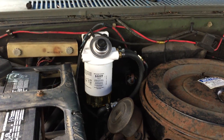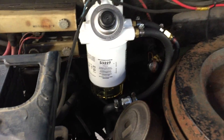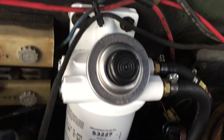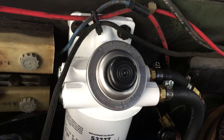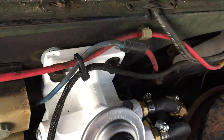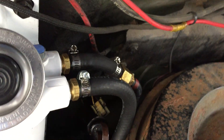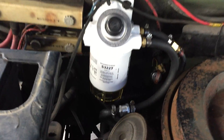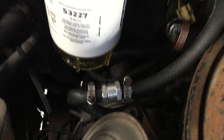While I wait on that, back to the filter. Just like that, we are all done. The filter body is bolted right into the original holes with the original screws, with a couple of washers behind it to give a little lift off the firewall. I've got the little 3/8" nipples coming off — one of them has a converter that brings it from 3/8" down to, I think, a quarter inch. The other one stays 3/8" all the way, and on that one I put one of those little check valves to keep the fuel from washing back into the tank.